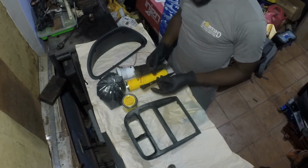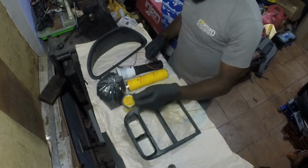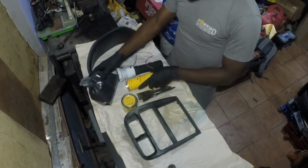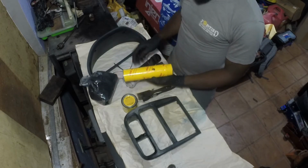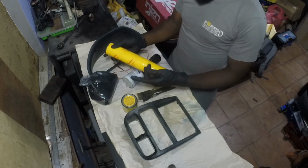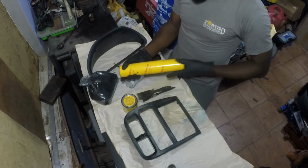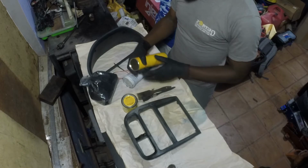You're going to need brushes of different sizes, and also a roller if you're going to have a bigger part. This is your bag of flock that you're going to be using, and your applicator. Now you have different applicators. This one is a mini flocker. What you do is load it up about half to 3/4 way, and in using it you use a pumping action like this, and the flock comes through these little holes.